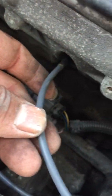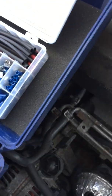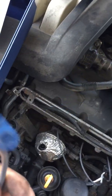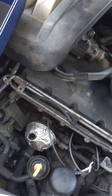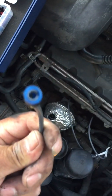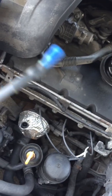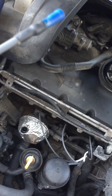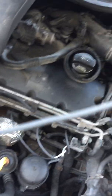I got some 12 gauge wire and I just use the regular blue connectors like so. This one I actually have to put on number four. I can't remember the number of the female connector, but basically the female connector — the one that sits snug on the glow plug itself — I used 12 gauge AWG wire again and put some shrink wrap on it.